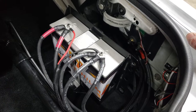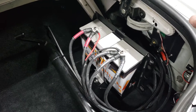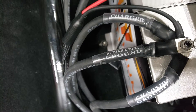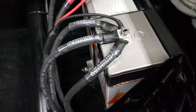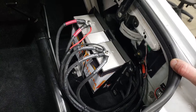This is how I wire cars — I've wired plenty of them and never had a problem. I run a ground from the battery to the chassis in the back of the car using a nutsert on the frame rail. Then another wire I labeled engine ground goes up to the engine block — it goes through a firewall bulkhead connector, straight to the block. Just because you have a motor plate in the car, don't rely upon that — run a wire. I buy 250 foot of four-gauge welding cable at a time. Typically a car with a rear-mounted battery uses right around 55 to 60 foot to do it right.